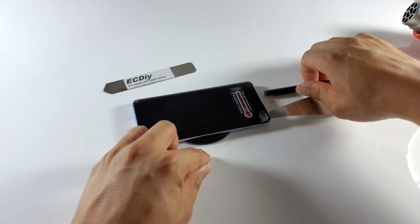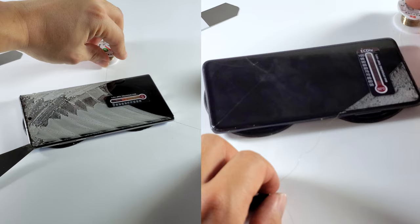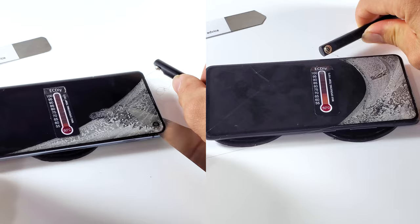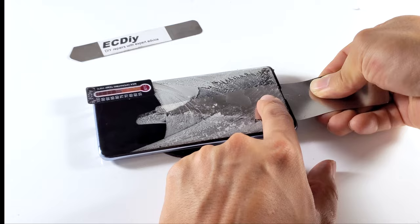Another important trick: divide the areas into three sections for the smoothest glass removal. The wire tool often gets caught — whether on an edge of broken glass or edge of the speaker grill cutout, just to name a few. When this happens, simply use the OCA blade to bridge the two sections, and as long as the wire is pulled under the OCA blade, the wire will be able to clear where it was getting caught before. I do want to stress that as with most DIY how-tos — whether it be home repair, car repair, or cooking — the process looks easier in the video than it actually is. Please ensure each step is followed carefully.